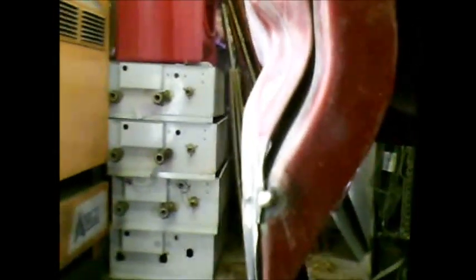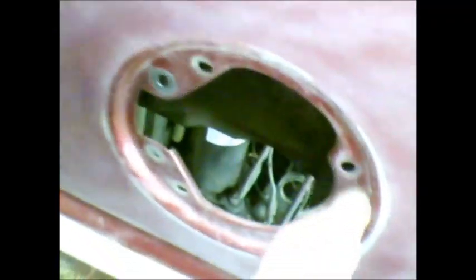I got this thing pretty well welded in here and everything seems to have went in pretty straight - no warpage. I got everything ground down with my angle grinder and got everything ready for some body filler. I went ahead and DA'd the panel and the side of it here, trying to get most of the clear off and also identify any low spots. I took a sharpie marker and identified the low spots - you can definitely tell where they are because they don't sand out real good. There are a few more spots than I thought, and there's one that's a little high that I'm going to knock down just a little bit. I took the gas filler door off and did around it, and I taped off around this molding so I wouldn't end up scarring it up.